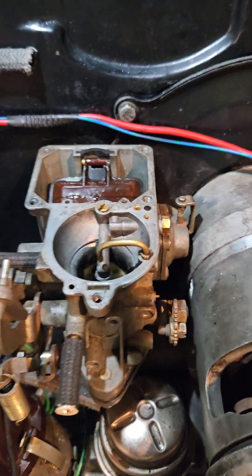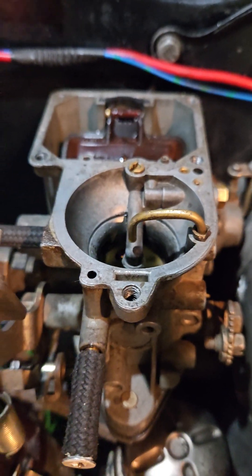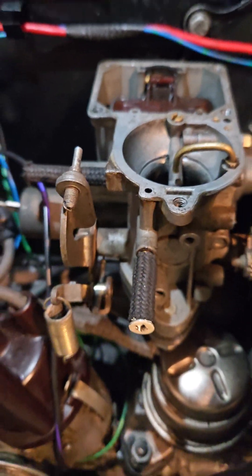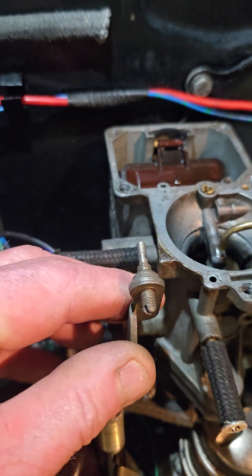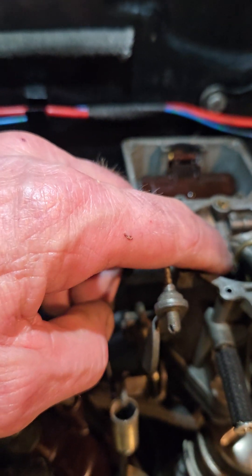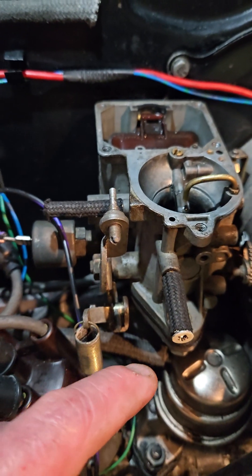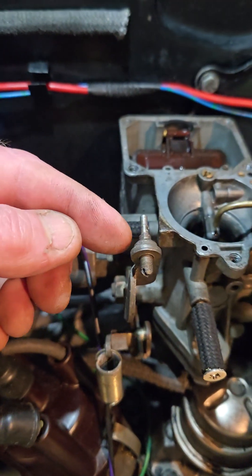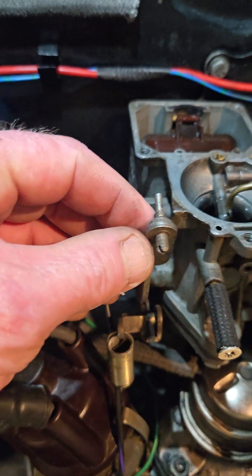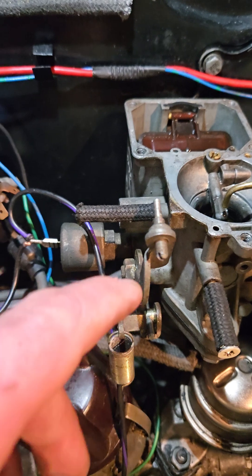If you have a flat spot, the first thing you do is mess with the nozzle — and it probably won't fix it. I've seen cars run perfectly with this thing plugged up completely on a dual port engine, stock. Typically when you have a flat spot and you move the throttle just a little, you get gas squirting out, and when you stop moving it, the gas stops. That's why the engine speeds up at first — because of that gas — but if you hold the throttle in that position, it'll start missing and cutting out and just die because there's not enough gas coming through.